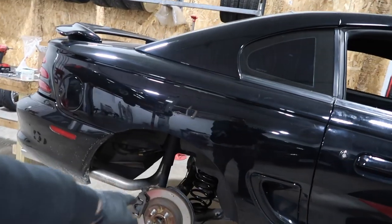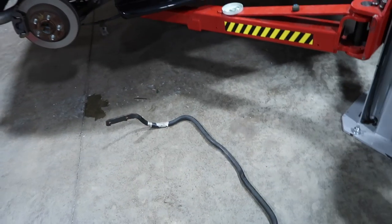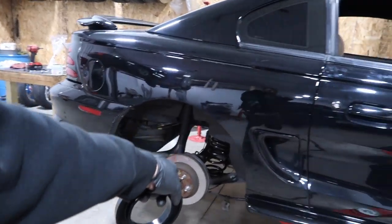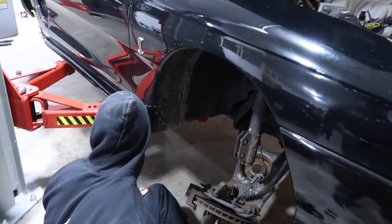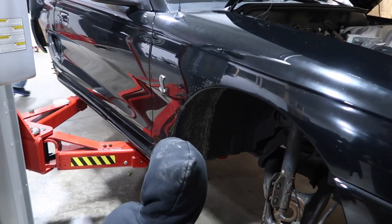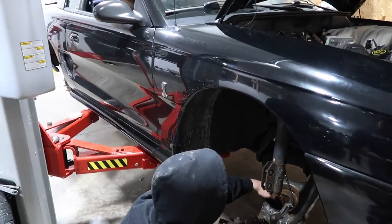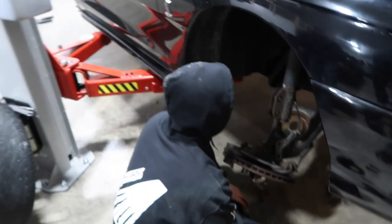On to the next phase — getting it on the rack and doing lowering springs, wheels and tires. We are pimping the Cobra. The rear Eibach Pro Kit spring is already in. I also have a set of Eibach Pro Kit front and rear sway bars going on this car. Dan's working on putting the front springs in, and I need to grab the rear sway bar. This thing is going to handle like night and day. I'm almost not even worried about the RTV drying because I want to drive it so bad.